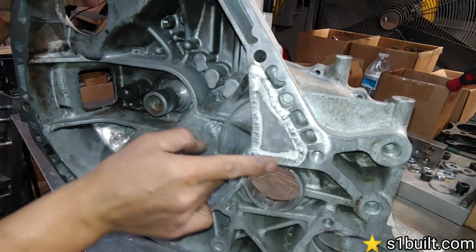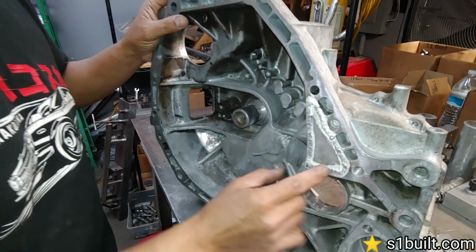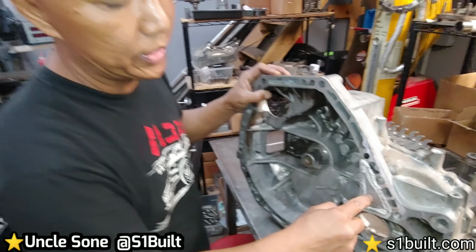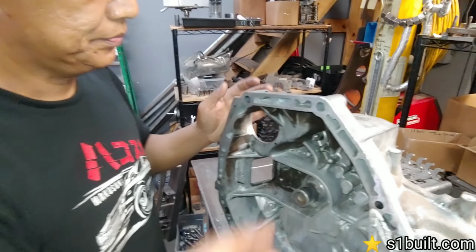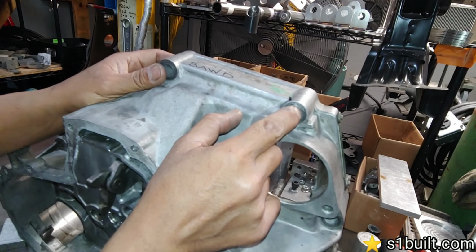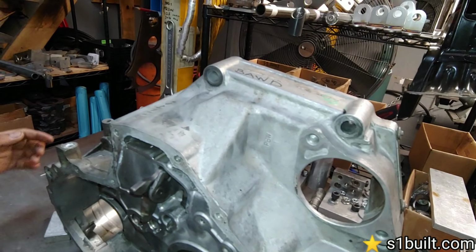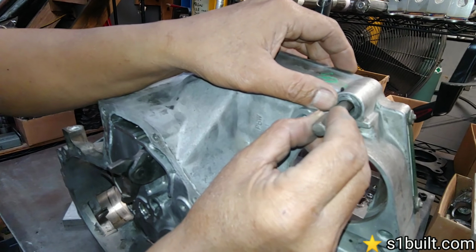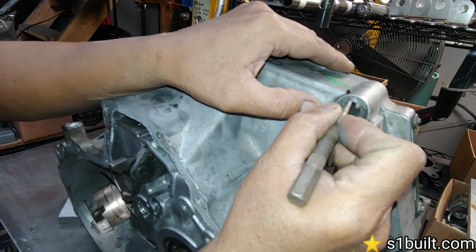We just got done welding this right here. And then what's going to happen is this right here is going to get drilled right in the middle here and tapped. It's pressed to fit in here. Then we're going to drill it and tap it, and that's where the bolt's going to hold from here. So it's perfect, it's right in the middle. The top one on this side here, we're going to drill just a little off of it. Instead of being centered like this, the bolt is actually here, so we have to drill just this small part off of here.